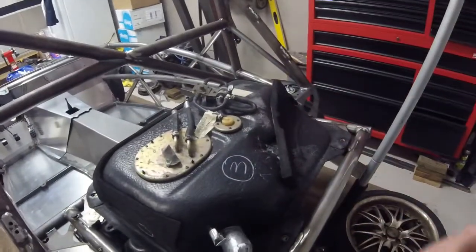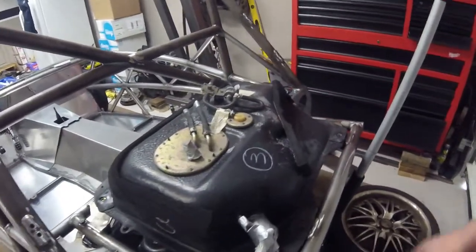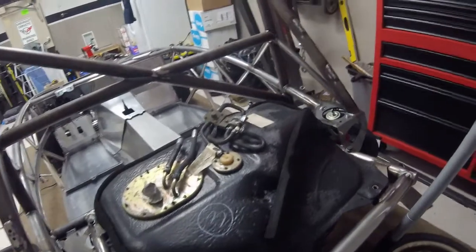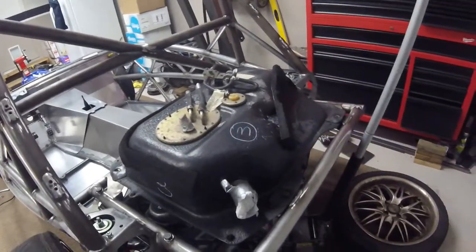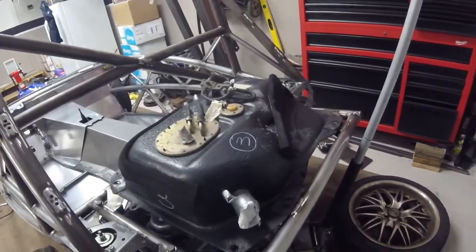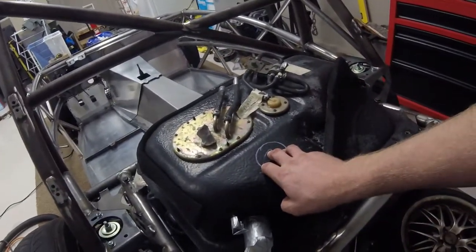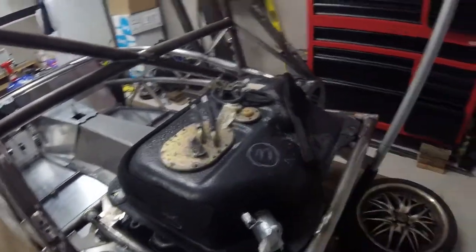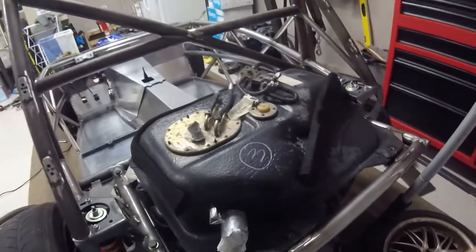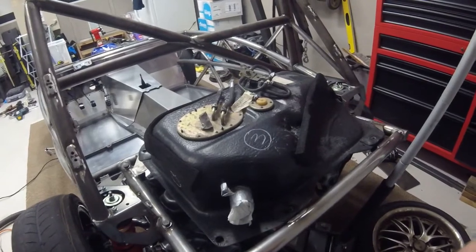You want to get as much height as possible in the rear and lower the front as much as possible in order to get the most fuel and the least amount of fuel starvation. A lot of guys because of this are running aftermarket fuel cells. I've considered doing so, but for right now I just want to keep it simple and mount the stock tank. In the future if I don't like it, I can always reweld and put on new brackets for an aftermarket fuel cell.